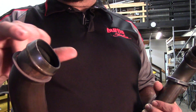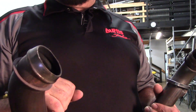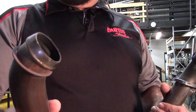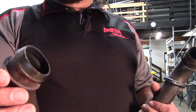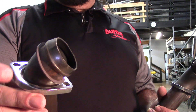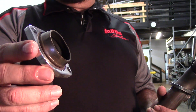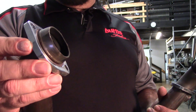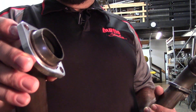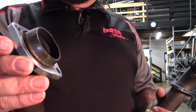The purpose of this is to do two things. First, it gives a kind of conical shape here that, with a conical gasket, allows sealing to occur and also allows a little bit of misalignment in the pipe. Second, this clip and this flange with a counterbore in it actually fits over this whole setup and is attached to the cylinder head with studs and nuts that are provided.